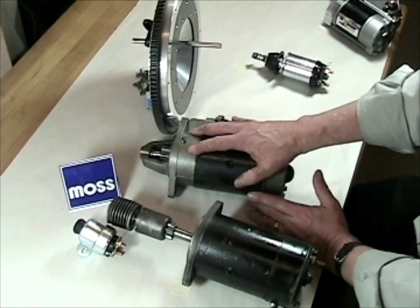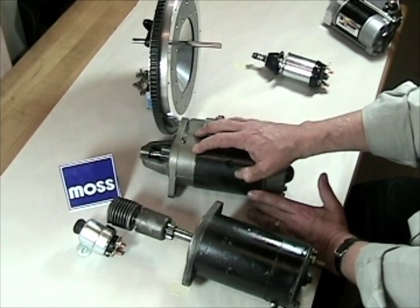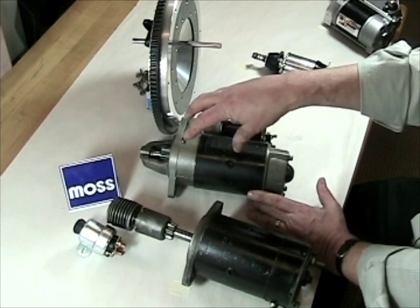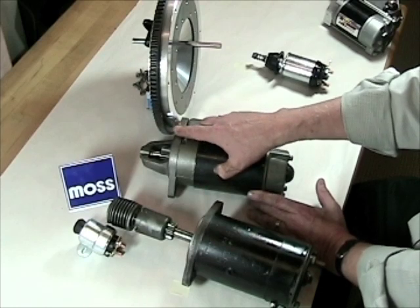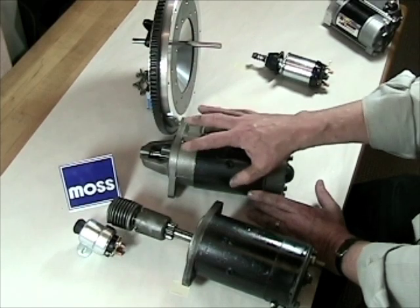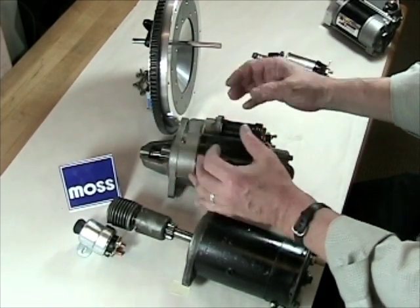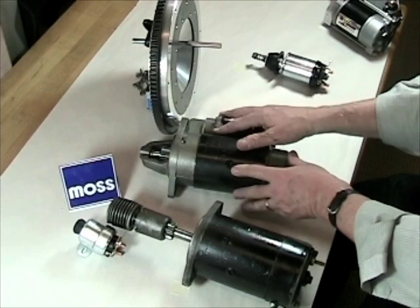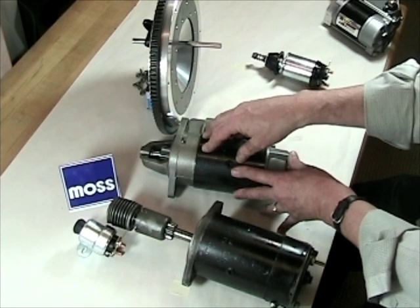Now this has negatives and advantages like everything else. The positive is obvious: we've eliminated the violent bang. The negative is that starter motors need a lot of electricity just to come to life — there's a lot of inertia to overcome. So this motor, when it comes to life, has to overcome its own inertia and try to turn the engine at the exact same moment. This motor is capable of doing that; she's got plenty of power to turn herself and the engine. But it requires a lot of electricity, which means your battery has to be in good shape, your battery terminals have to be clean and tight, your cables and their ends have to be in good shape, and the ground strap from your frame to your motor has to be in good shape. If all those things are in place, this runs beautifully. If any of them are not up to snuff, this isn't going to function the way you want it to and it's going to fail.